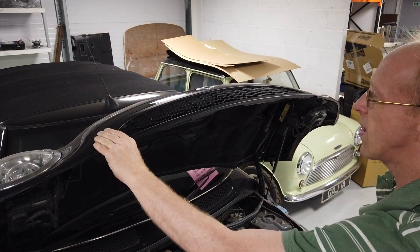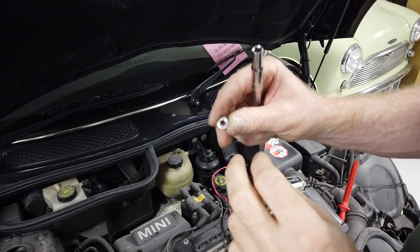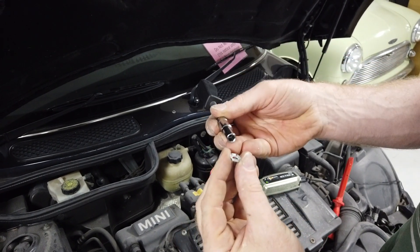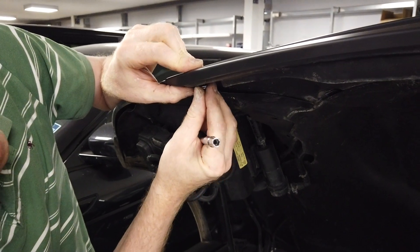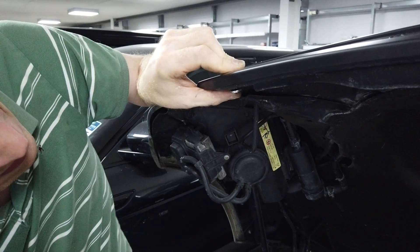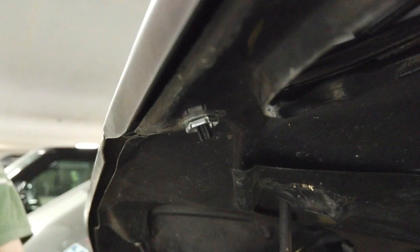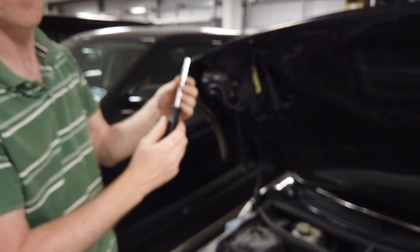With the grill in position and clicked in, you need one flat washer and one of these clips — they're rolled on one face to help line up. I'm using a 6mm socket pushed on the inside face so there's room for the pin to go in while still pushing on the washer. I managed to get one on just with my thumbs, then used the 6mm socket to give it a good push. That's the trick for getting those clips back on.